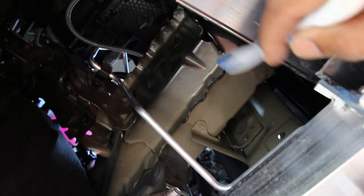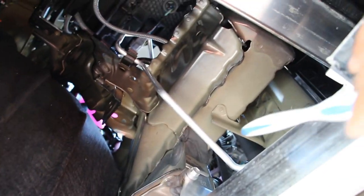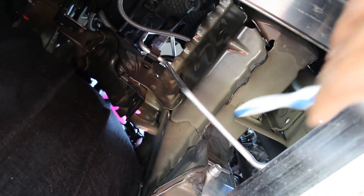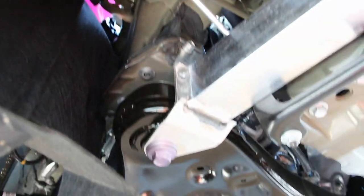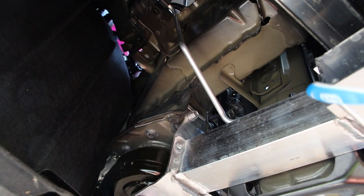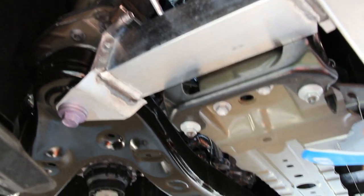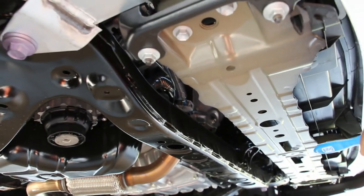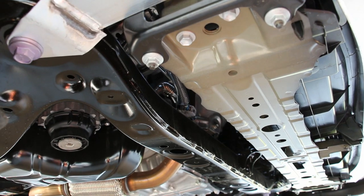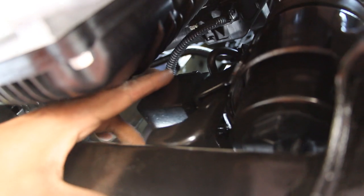That steel radiator cradle continues all the way up to the top and across the top, supporting the wheel well inside. Not a lot of newer vehicles have this — on many, the radiator cradle is just made of plastic and the only steel that extends to the front is the single bumper reinforcement, with everything else plastic and no front subframe reinforcement. While this design is going to be a little bit heavier, I think it's going to be a little bit more sturdy, especially in a moderate to low speed crash. The front part of this subframe has also got one of these vibration isolators made of rubber.